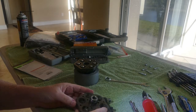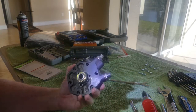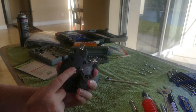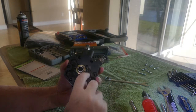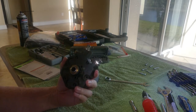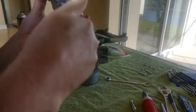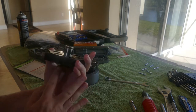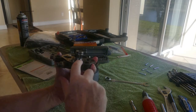The tricky part is that this post has to point a certain direction. If you look, there's a slot here that tells you. Before you take this post off, put an etching mark on here to help you know where it goes — I actually have several etchings in here. That mark right there points to your etching, and it should line up perfectly with this hole and that hole; they all should line up.